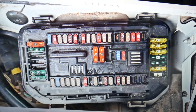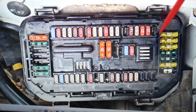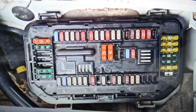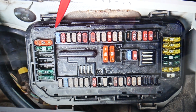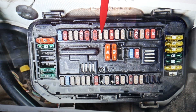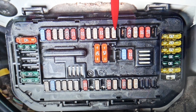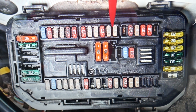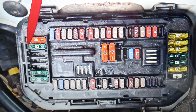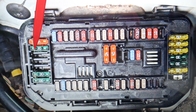So here's what we need to check — three fuses need to be checked if you have ABS and brake light on. This is towards the windshield side, the front of the BMW, passenger side and driver side. We'll start with fuse number 25 — count from fuse 18 along the row to reach fuse 25. Then we also need to check fuse number 29. We have another one — this is the main ABS pump fuse and traction control, and we're talking about fuse number 58, which is a 30-amp fuse.